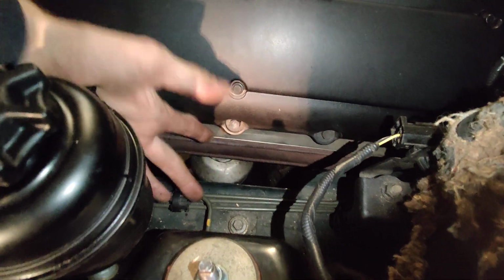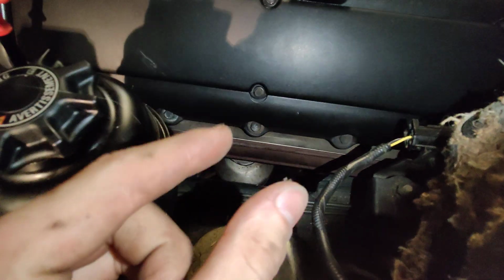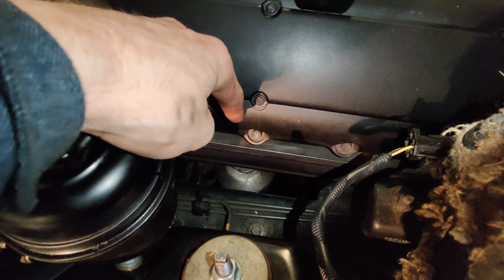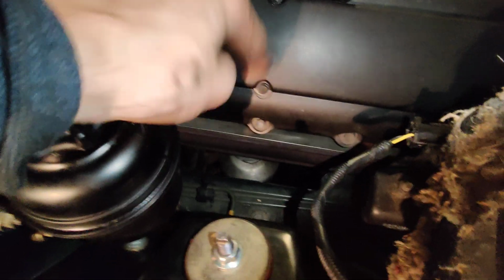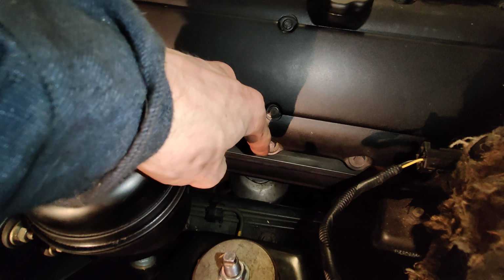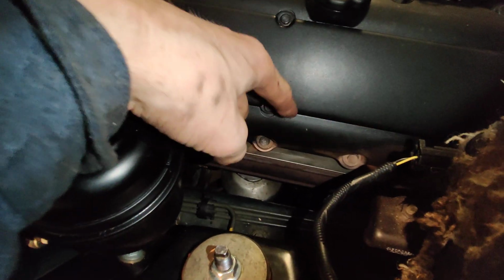And the back of the engine mount in there has a hole in it, so if you push the bolt too far back there, it will fall into the subframe and it will get lost forever, and there's a 50-50 chance it will fall into the subframe and get lost. Sometimes it falls all the way through, but it doesn't always.